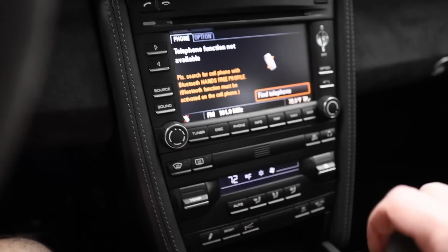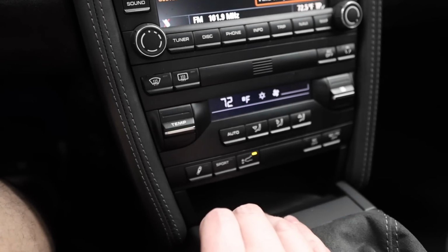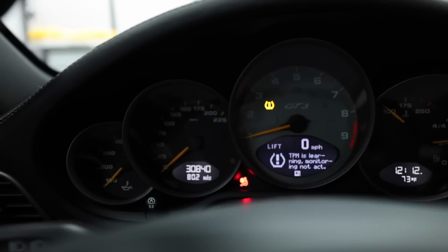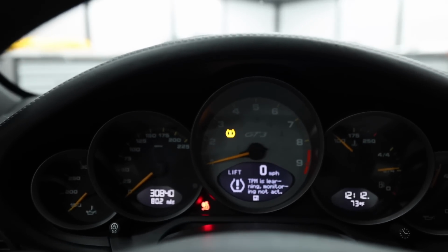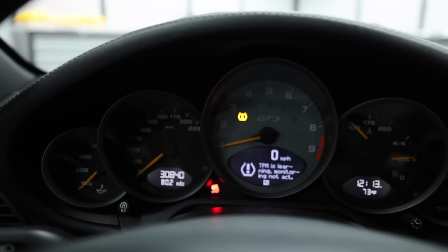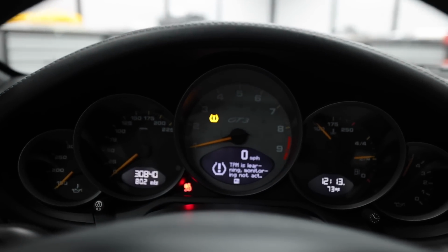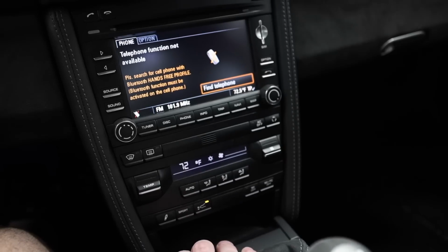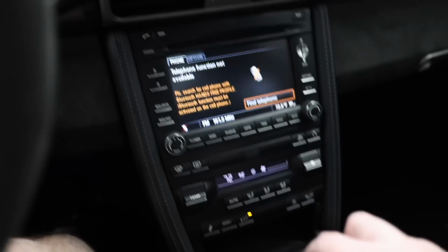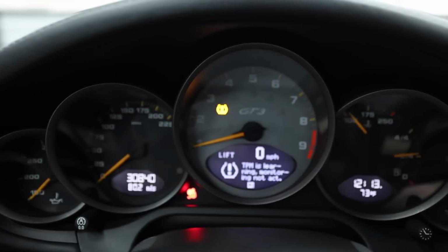So if your axle lift does this, where I press the button, the car lifts, it should then say lift. If it doesn't say lift, then it's very likely that pressure switch. And so now I can press the button again, and the lift will go down and lift goes away. Nice. So $400 instead of $15,000 will fix your axle lift by replacing that part that I put in the description. What happens is if the pressure switch is malfunctioning, the car never knows that the lift is actually engaged, even though it is engaged and the car is lifted.